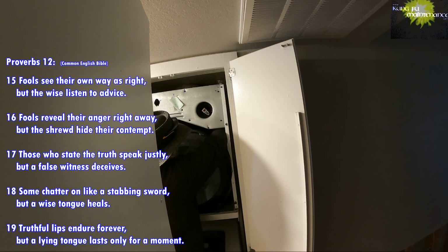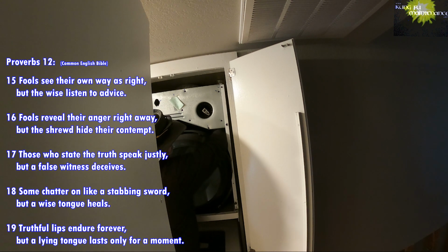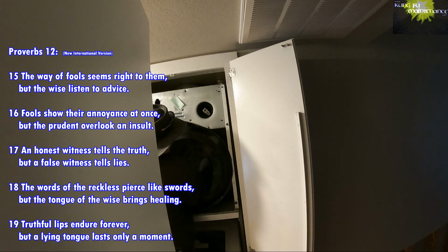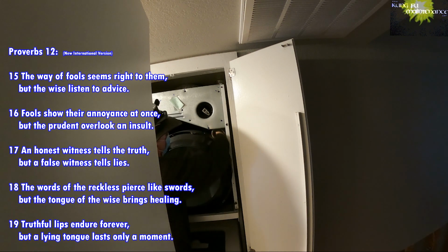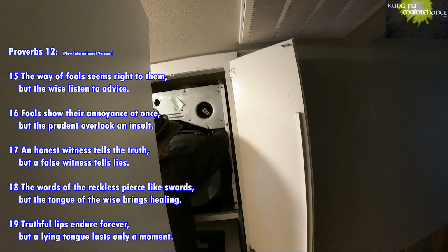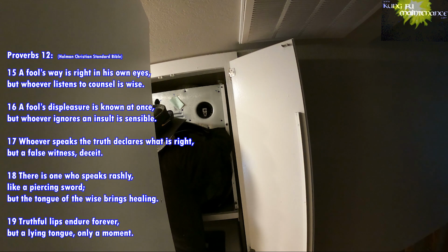And what we're going to do is hang the belt, in theory, over the motor first. And then we'll get that around the first piece and then the pulley. So now I'm going to make sure it's centered so it'll pop up to where we want it, and then pull the pulley around. And I'm using my gloved finger to guide this, in theory, around the pulley.